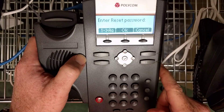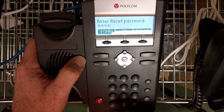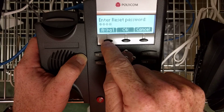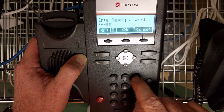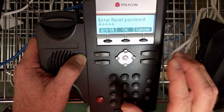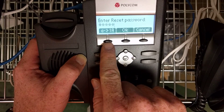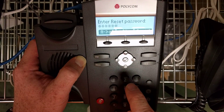The MAC address needs to be entered alphanumerically. So in this case, 0, 0, 0, 4. The alphabetical characters need to be entered as lowercase. You'll press the upper left-hand key next to the screen twice to get a lowercase alpha character. In order to enter an F, press the 3 key three times. Please note that the phone does not show you what key you've entered, so you need to be very careful to enter the precise number of digits — three times to get an F, for example. You can click back to numeric characters and back and forth until you've entered the entire MAC address.